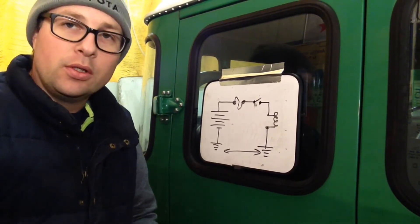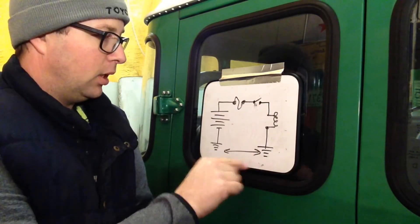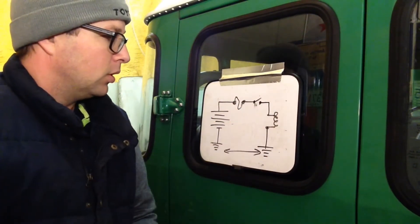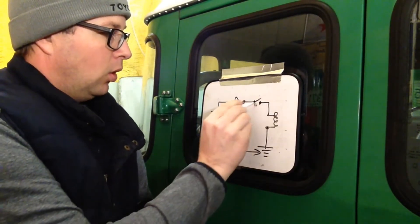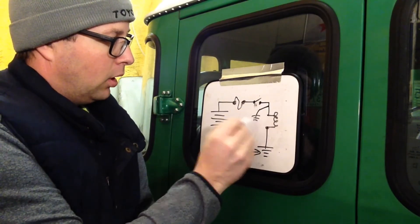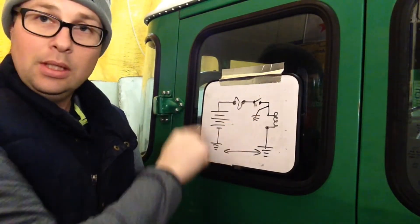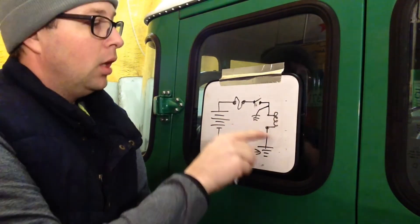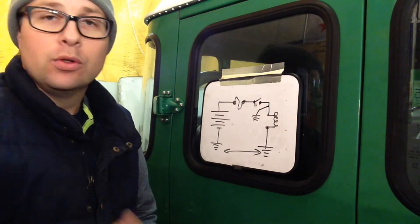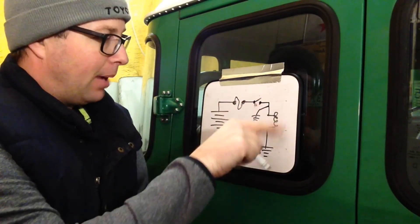The other thing we can have is a short circuit, and a lot of people refer to any electrical problem as a short circuit. If you have a short circuit, you're missing the load. If the electricity cannot get to the load, it's not going to light up. So let's say on this side of the switch, or on the wire in between the switch and here, somehow this has contacted the frame and we have a ground here. The electricity is going to go back to ground this way because it's easier — it doesn't have to do any work, it does not have to go through the load, and the load is not going to light up. Or if this is a bad ground, a high resistance ground — which we'll talk about later — then the light bulb may light up dimly, but most of the power is bypassing the load.